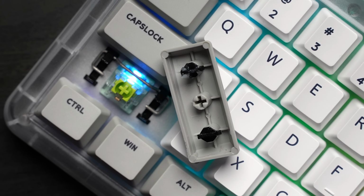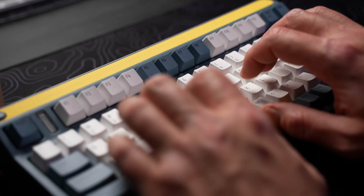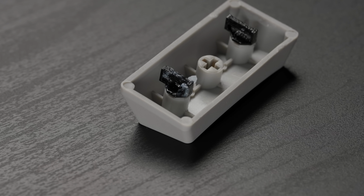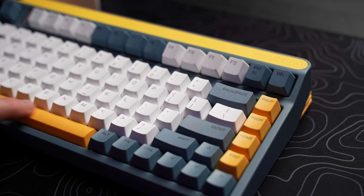If you're not into keyboards and you pull one of these off, you're going to regret it when you try to put it back on. But going over all these boards right out of the box, they don't sound to me like they need modding even. It's obvious that there's some solid factory lube going on here even without looking, and the stabilizers, CoStars included, feel and sound really good, like light years ahead of what you get from the likes of Razer, Corsair, Logitech, etc. But the Cherry plate mount stabs surely sound better than the CoStars, right? We'll talk about that in a sec.